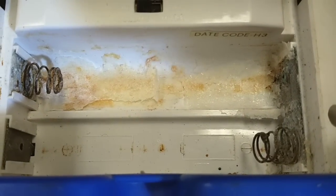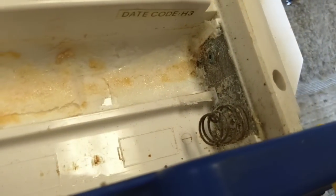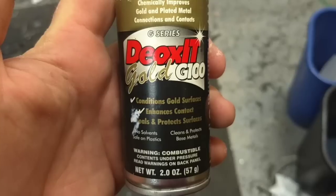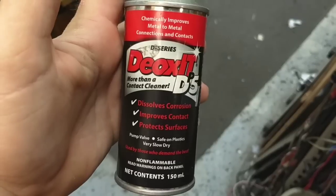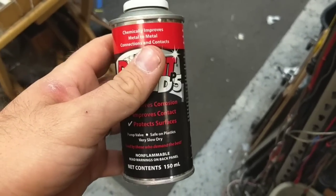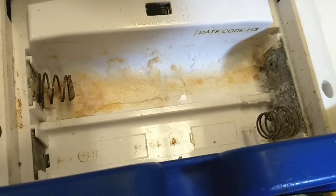Here's our lovely crusty battery compartment. There are ways to get this off — most of the time a baking soda and water solution will work, but I don't want to get water inside. I have some corrosion inhibitors here: the Deox G100 can work, as well as the D5P, a higher concentration of Deox, if you don't want to spend $20 on that tiny can. Either way, just apply the chemical liberally and scrub and scrape to get those terminals cleaned up. After a brief soaking and scrub with a toothbrush, the Deox cleaned up most of the garbage. I resurfaced the contacts with a little Dremel.